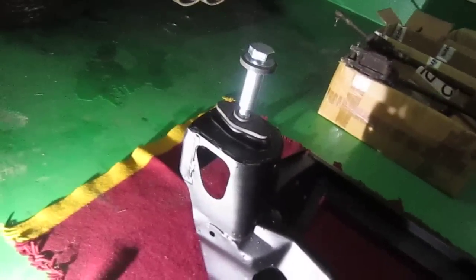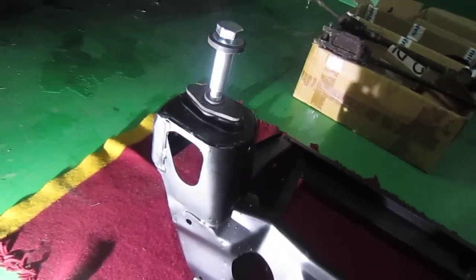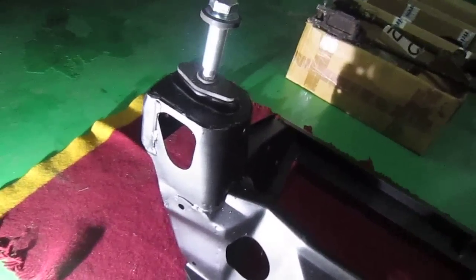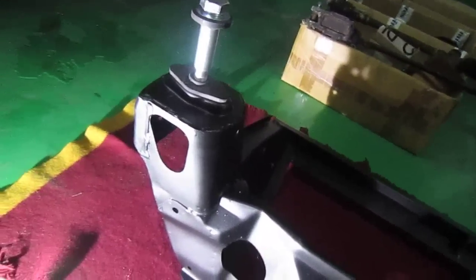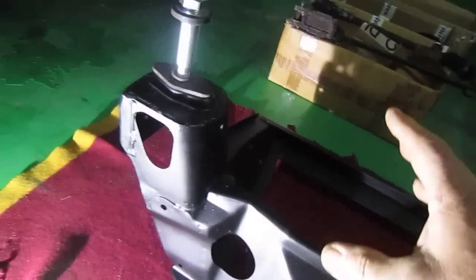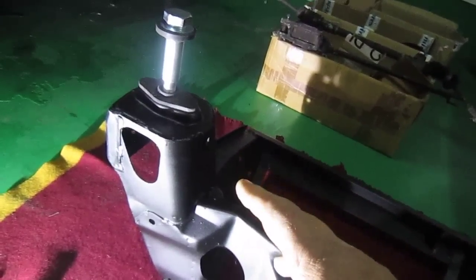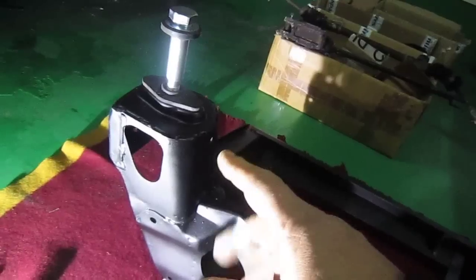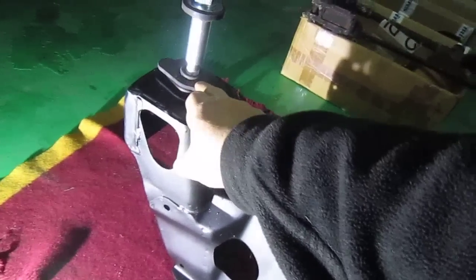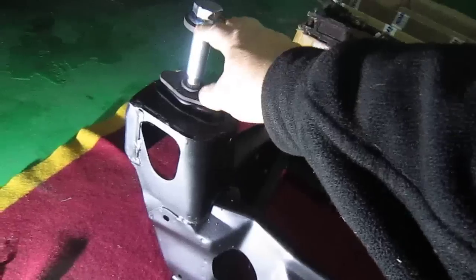This guy works for a company in Graz — they build the AMG Mercedes G-wagons, specialised customer orders. So he really knows his stuff, but with minis he knows even more — unbelievable knowledge. He's saying that when you think about it, if you've got the steering on the bulkhead attached to the car, and this is attached to the bulkhead by these bolts, and your steering is attached to the front subframe — you get movement, possibly as much as three-quarters of an inch to an inch when you're steering.